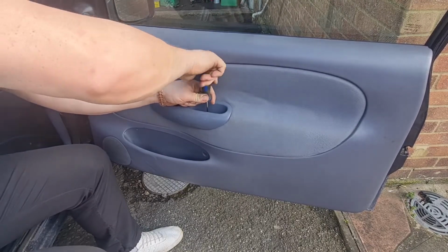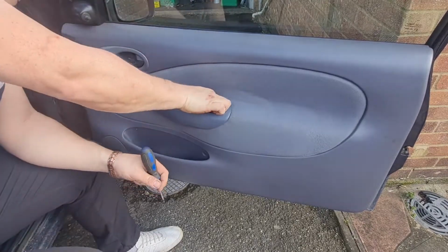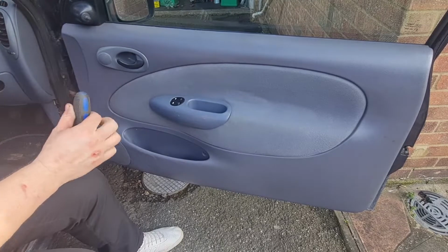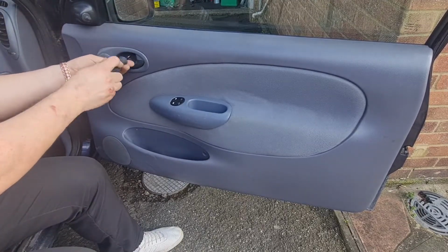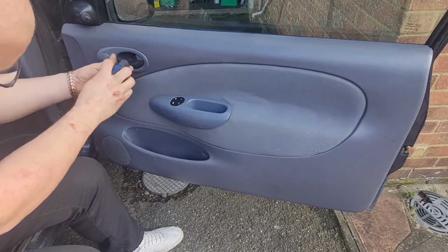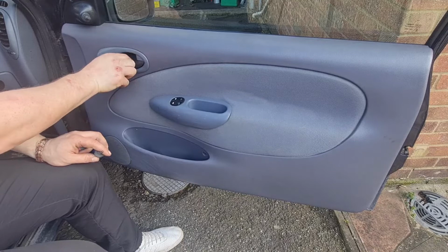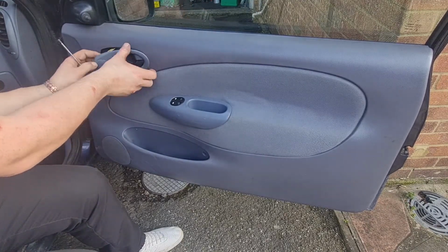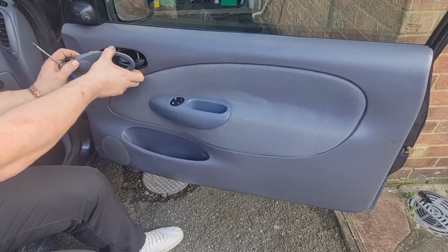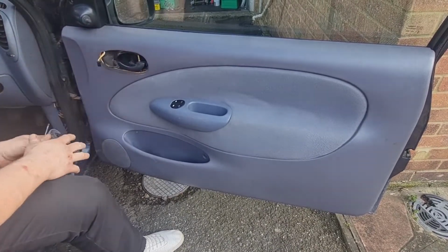This car has also been nicknamed Donkey, mainly because it doesn't ever give up, no matter what is thrown at it. The reason it had a new engine, by the way, is because the cam belt tensioner gave up and it skipped a tooth. So rather than faff around trying to repair that engine, we got a good second-hand engine which had done low mileage for not a lot of money. I just swapped the whole thing over.